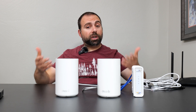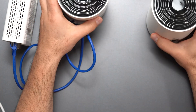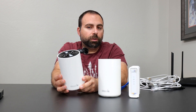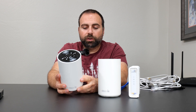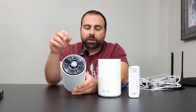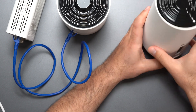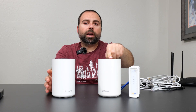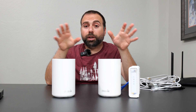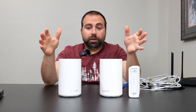The other option — more convenient and easier — is called wireless backhaul. The main router is always hooked up to the modem via Ethernet, but the second unit is placed one or two rooms away, around 35–40 feet, depending on your home. The app tells you if it's a great, good, or bad connection. You just plug the second unit into power and it wirelessly talks to the main unit. If you buy them as a set, the Deco app already knows that, so you just power it on and it automatically connects. Super simple — you've created a wireless backhaul network.